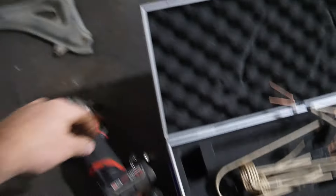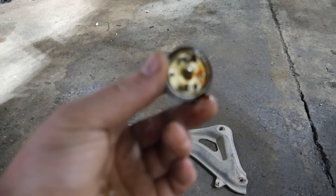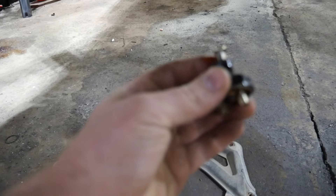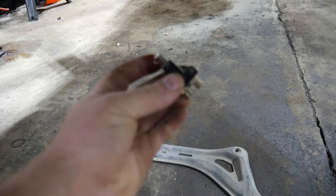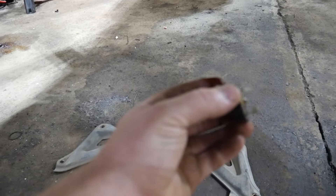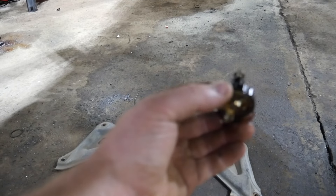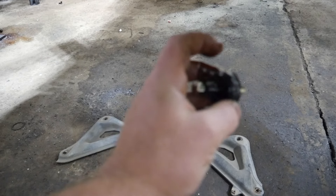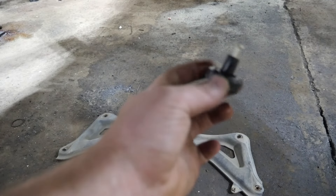So the oil is still just barely dripping down into our pan. This is a last resort plug — when you tighten this wing nut down, it pulls this rubber in and it'll seal a stripped out oil pan. You can use this for a while. My only gripe is that eventually this rubber is going to get brittle and break down over time. But it is a great temporary fix if you're in a pinch.